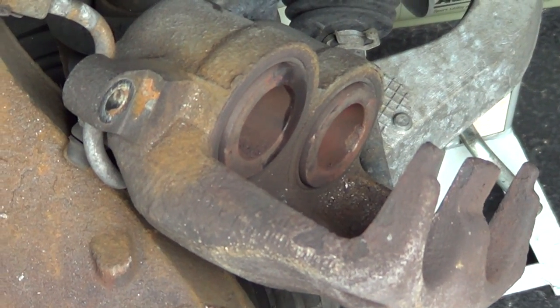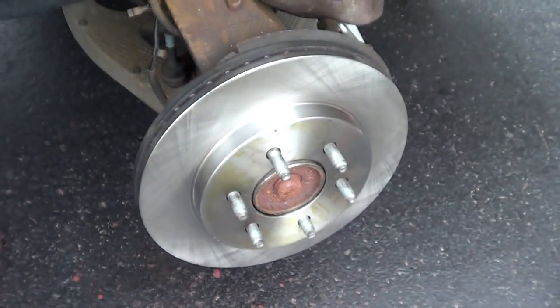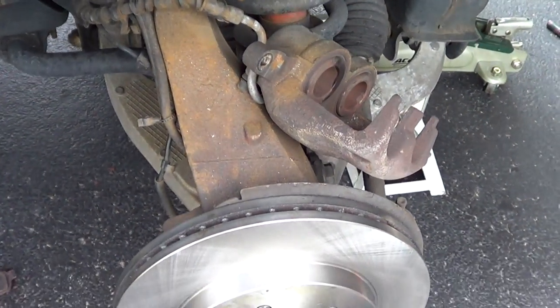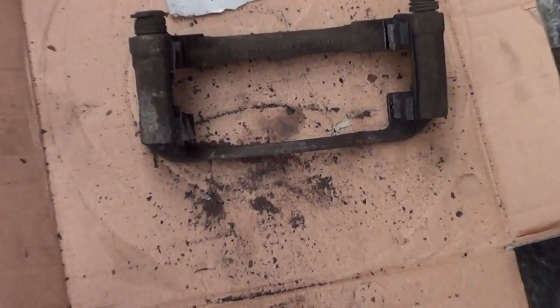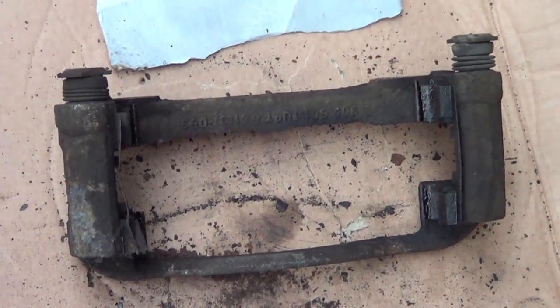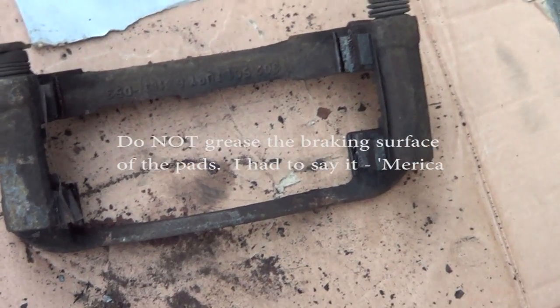Here's the caliper all compressed and we've slid a new rotor on here too so you can see how that looks. Even though that looks concerning on the caliper there, that's not brake fluid — I didn't puncture anything, it was a little spare oil I got on there. This is the bracket before it goes back on. The hardware on the sides is the old hardware; with my brake pads I got a new hardware kit, and you want to make sure you install that and grease everywhere where the brake pads are going to touch so that it doesn't seize up on you and give you problems.